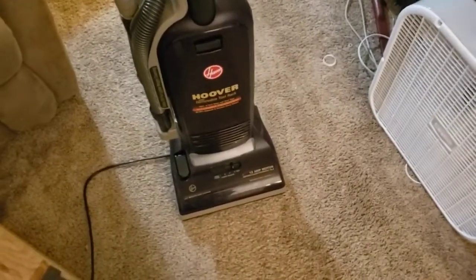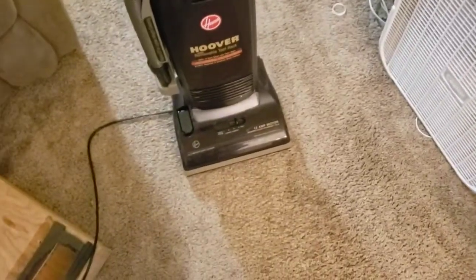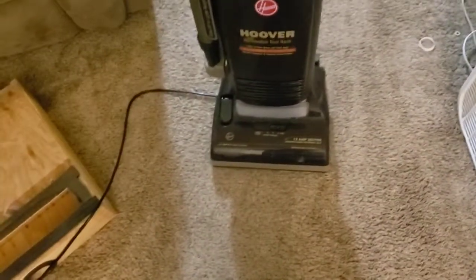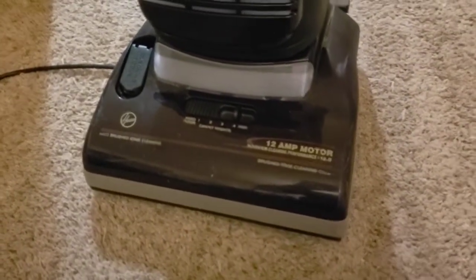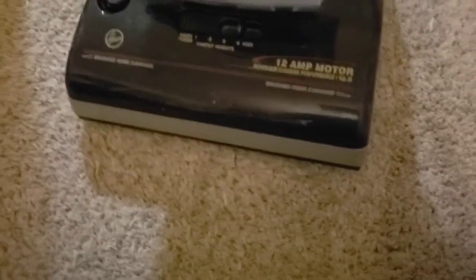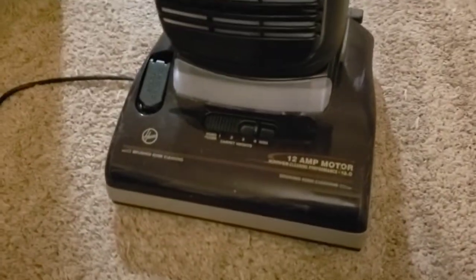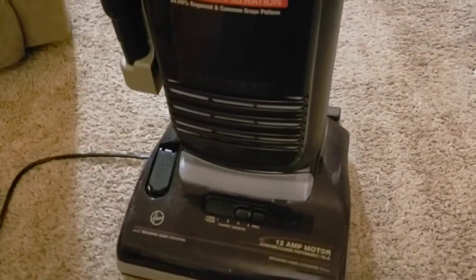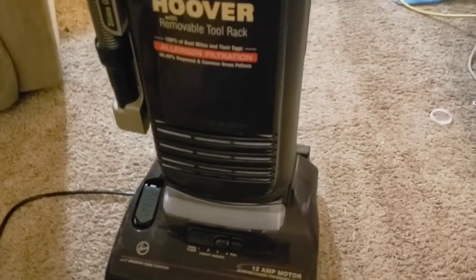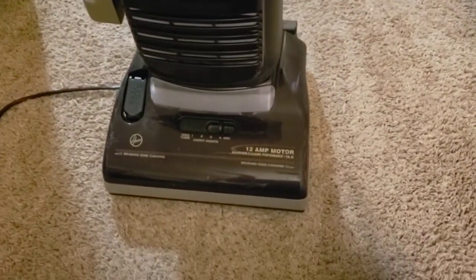It's been a long time since I've worked on one of these, but this must have been done towards the end of the Elite-style machines, and they definitely made some improvements. With the old Elites, you often had to remove the hood to get at the belt because you had to access the pulley by taking the hood off. But on these, removing the base plate reveals an entire channel that goes all the way to the pulley — that's a nice little change.